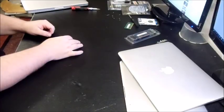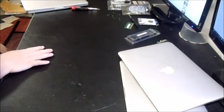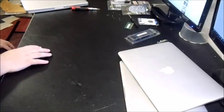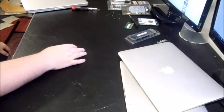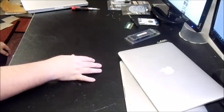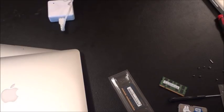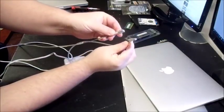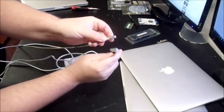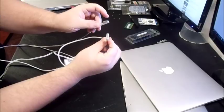Power cords come in 45-watt, 65-watt, and 85-watt. Larger screens and retina displays require the 85-watt; most regular MacBook Pros and white MacBooks require 65-watt. You can use them interchangeably as long as the wattage matches. The newer connectors are called MagSafe 2 — they have a thicker look and started coming out around 2013. This is a regular MagSafe and that's a MagSafe 2, which goes on all newer MacBooks from 2013 onward.